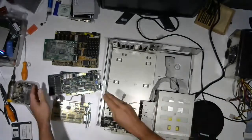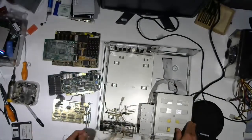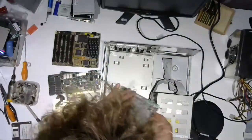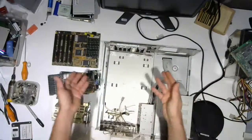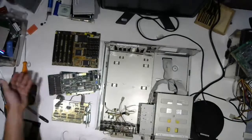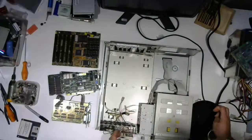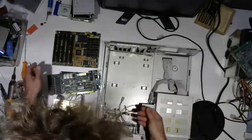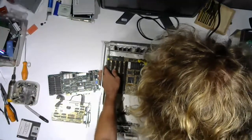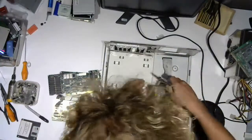Tonight, it's just let's get the crap in and posted, maybe booted, because I know that the hard drive has DOS on it and Windows, and I bench tested all this stuff, except this, for bootability, and I ran the CheckIt program on it, multiple passes of the RAM, so that should be good. So having said that, let's get this in and going, I suppose. We'll start with the motherboard. It's ridiculously tiny compared to this case, so already this standoff can go. I'm semi-prepared today.